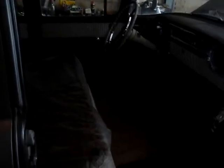Inside, you probably can't see, but I changed the front floors because they're rotten, to say the least, when your feet disappear through the floor, so that ought to come out. But anyway, today I've got to disconnect, oh, you can't even see it, can you? Disconnect this prop shaft, support the engine, support the trans, get it unbolted, and get it ready for lifting.